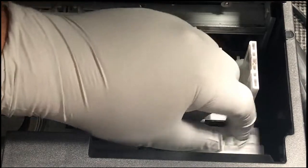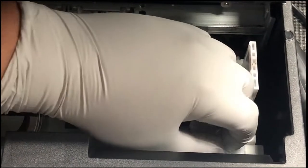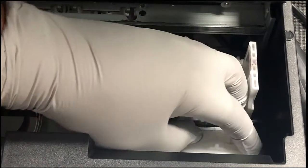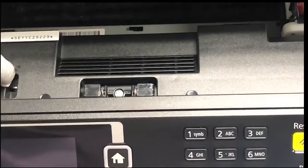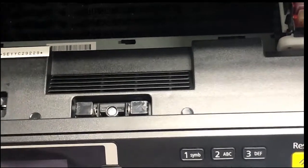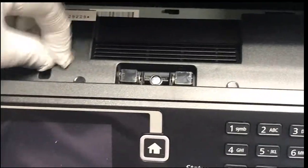This piece also gets moved during shipment. If it's in some kind of awkward position, that can cause error 0x69. This slot is the trigger for the printer lid. When the printer is closed, there's a notch that jams into this slot.